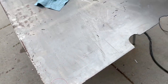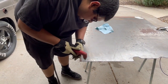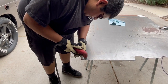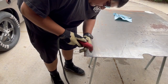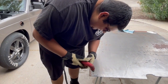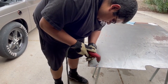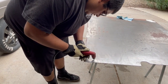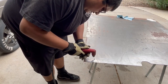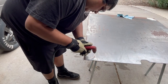George is gonna try the plasma cutter out. He's never used one before. We're gonna see how well he can cut a circle. A little bit closer. Maybe 1/8 inch is too much. He's barely above it. Every single movement. Yeah. It's cutting out like that because it's losing the ground, so you just need to be a little bit closer. You're probably getting further away as you go. Maybe.